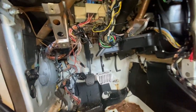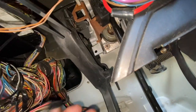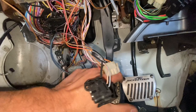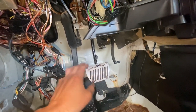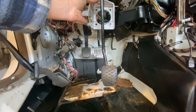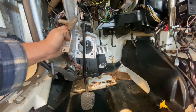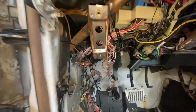Here's our pedal — we got everything nicely greased up. We're just going to slide it onto that rod which is also greased. I put the clutch on just the way I described. The master cylinder still needs to be attached — that will go there with the pin through it, and the spring assembly goes up there. I just realized the brake pedal on the automatic is different — look, there's the automatic brake pedal and here is the one off of the manual. It's skinnier and it goes a little bit over to the right.